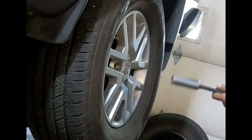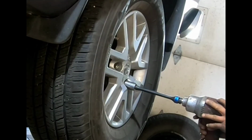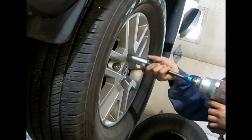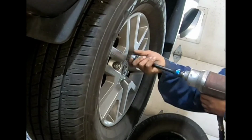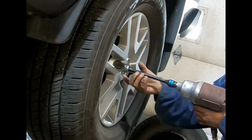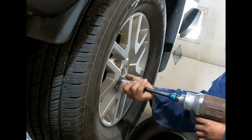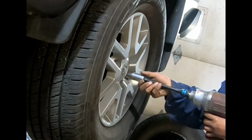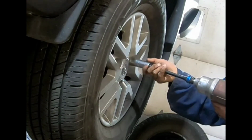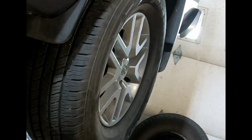Using this also on a truck again, like a small truck. So it's only like 100 foot-pounds. I use the color blue. Like I said, guys, every torque stick has an equivalent color for the range of its torque. Like I think red is 90 foot-pounds. The blue, which is the one we commonly use, has a maximum torque of 100 foot-pounds. The green is usually for light trucks, 150 foot-pounds. The silver is next, 120 foot-pounds.